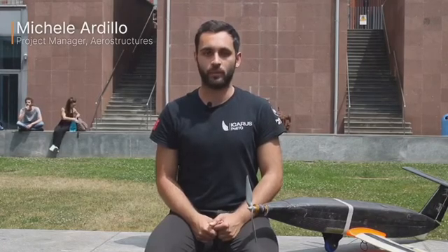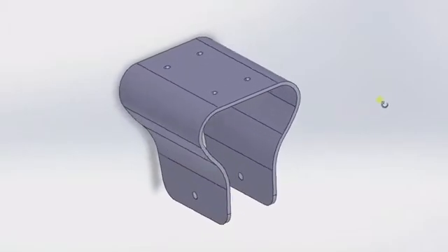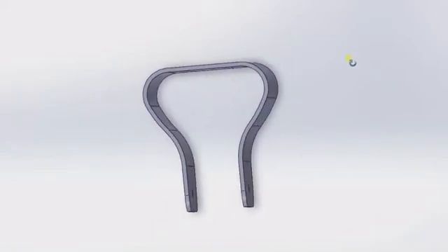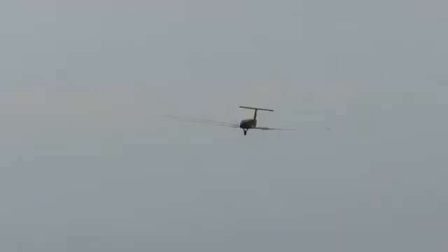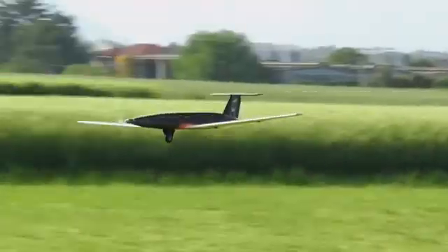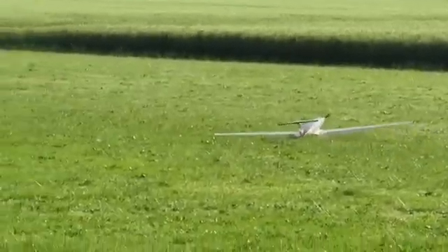The single-wheel landing system is a distinctive feature introduced for the first time with this new model. It consists of a short-wheeled leg and a tail skid, plus two appendages installed below the wing. The solution is somewhat more difficult to set up than the classic two-wheels gear, because it requires accurate fine-tuning. However, in spite of its cumbersome setup, the single wheel shows lower weight, friction, and aerodynamic drag, but also higher stability — useful perks if the aircraft has to take off from rough surfaces.